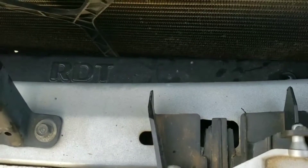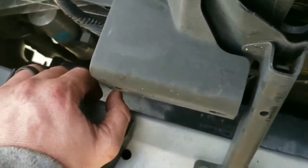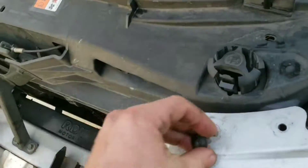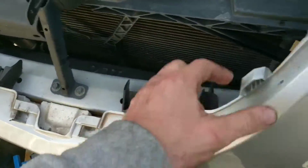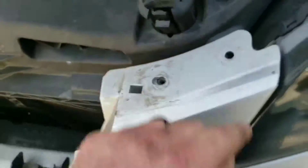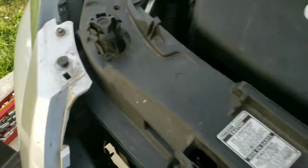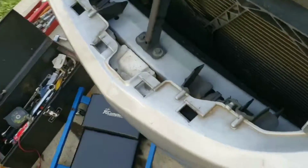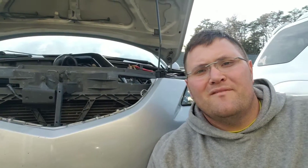You could possibly do this without removing your bumper, but I found it easier to remove it. If you go that route, you'll have to take out these screws right here that hold your front plate in — literally just two screws, one here and one over there, and these just pop out. You've also got a bolt here and a bolt right there. The rest of your bolts are on the inside of your bumper — if you pull back your wheel well you'll see one or two in that area. If you still have the bottom shroud you'll have to take that off as well.